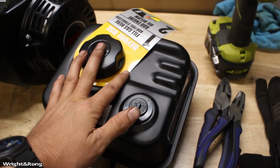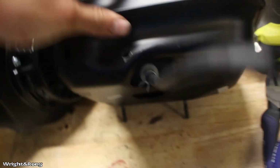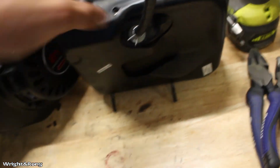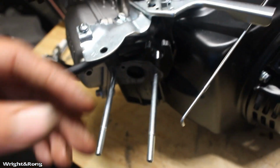Alrighty, the tank is off. I lied. I did go ahead and take the airbox off and the carb off because you have to in order to remove the clamp off the fuel hose, and I'd rather do it on the carb side than the tank side because that's going to make it hard to get back on. So I pulled the carb off and everything like that, and actually you need to do that anyway